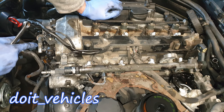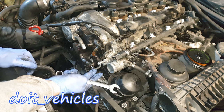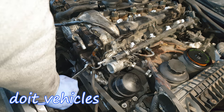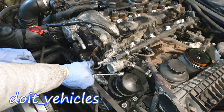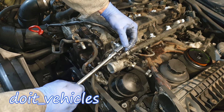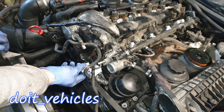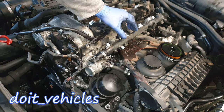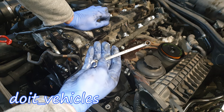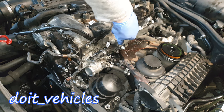Here is the washer — try not to lose that. Let's disconnect the delivery line which comes from the fuel pump, then disconnect the same line from the high pressure fuel pump with the same 14mm. With the E10 you've got a bolt which holds the bracket with the fuel line on. Make sure the fuel doesn't go on the serpentine belt because you're gonna have problems in the future. The fuel rail is connected on the engine head with two E10 bolts.